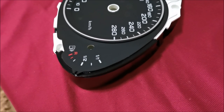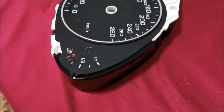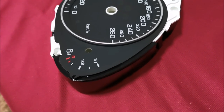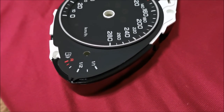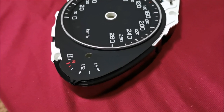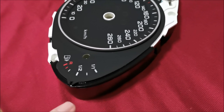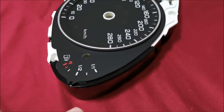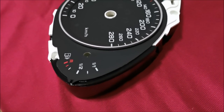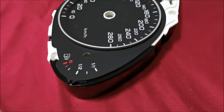In the end the paint is not as matte as I thought it would be, mainly because I put too thick a layer. I should have put a really thin layer, waited a few hours, then put another really thin layer. I was a bit impatient. I could fix this by letting it completely dry and putting just a thin layer on top, but I don't think this will bother me enough to wait. Maybe when it fully cures it will be a bit more matte. Anyway, good enough for me — it's not white for sure. Let's put in the needles and start putting this thing back together. Make sure there is no dust on the dials or inside the glass when you close it.